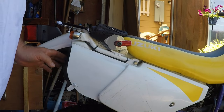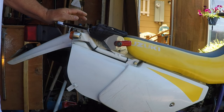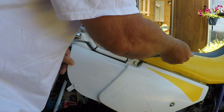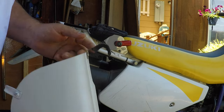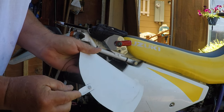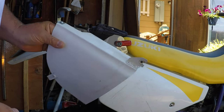For protection on my exhaust, I have made this plate — an extender of my side plate. It removes with one bolt. You just loosen this bolt and it slides off just like that. It has a clip here that clips over my turn signal and a bracket that the D-ring on the bag hooks onto. It's a very simple little thing and it works great.